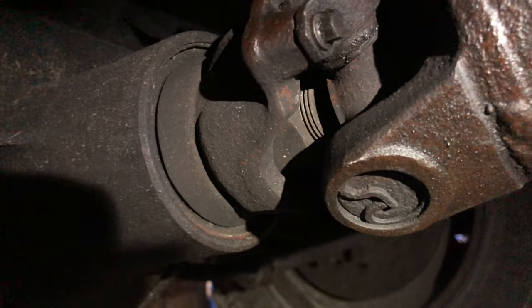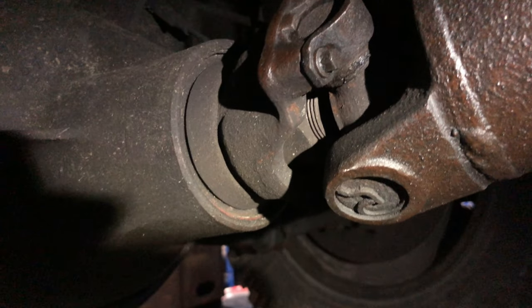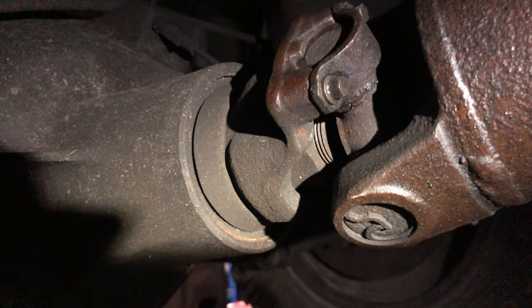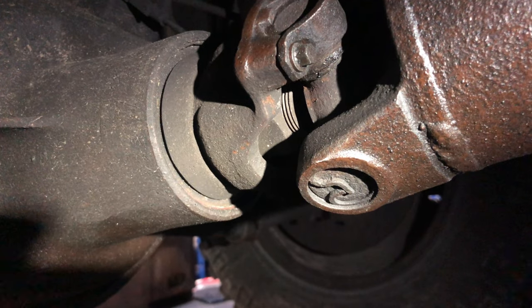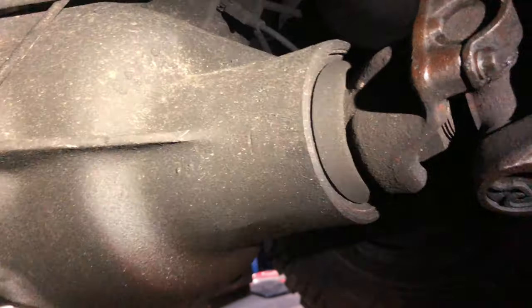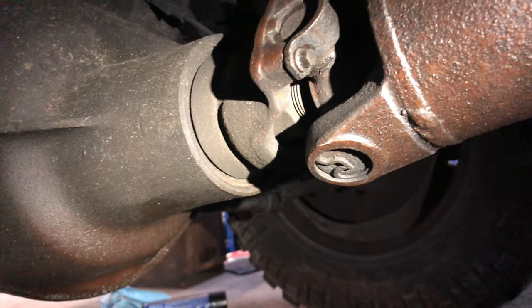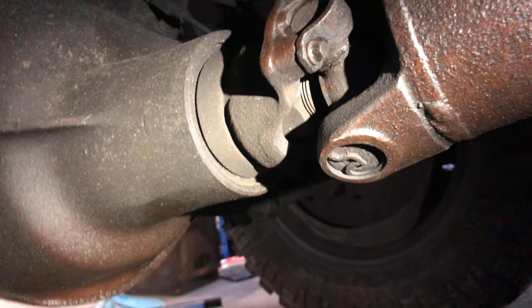Right in there you can see the threads — that is the pinion nut. Part of the way you get a certain pinion preload is by how tight you tighten that, and there's a range — I believe it's about 420 to 450 foot-pounds, don't quote me on that. The range is also dictated by how you have the shims in between the races in the inner and outer pinion bearing, just inside this sleeve. I strongly recommend downloading the manual from Dana and really going through it until you understand how these clearances are made, because there are a lot of concepts you need to understand before you get into it.